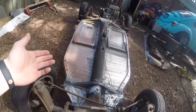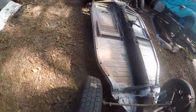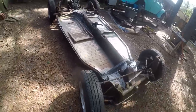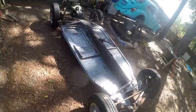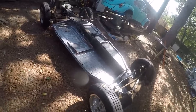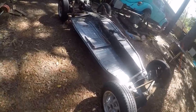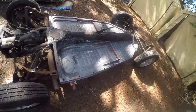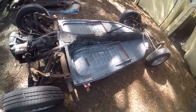Passenger side actually flash rusted — it's supposed to have a zinc coating on it, it's not supposed to do that. The driver's side didn't. So I'm going to give it an acid bath one more time, and let it sit a little while longer before we get that coat of paint on there. It's the first time I have ever seen a floor pan flash rust after leaving it out overnight. It must have been excessively humid or something. Either that or the zinc coating on it is substandard or poor quality, but that'll be no longer a problem because now it'll be covered in iron phosphate, which might as well be plated with zinc. So I just got to let it dry — it's sunny, so it shouldn't take too awfully long.